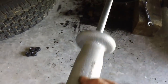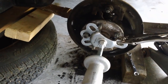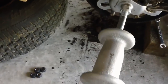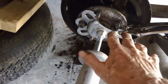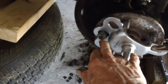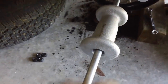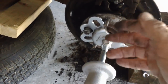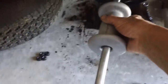This is what's called a slide hammer. It's a heavy weight on a rod. I borrowed it from O'Reilly's Auto - all your auto parts stores have a loaner program. You give them, I think it was $72 for this as a deposit. There's a ball on the end that this thing hits against when you slide it back and forth. I've got it hooked to that round flange with just one bolt - this thing was not designed for an older American car, so all I could get was one bolt through here. I used my vice grip to hold the other side. You don't have to slam this thing - just a tapping. After you've got your bolts loose, the axle will just come right out, as long as it doesn't have that clip or pin or retaining bolt inside the differential.